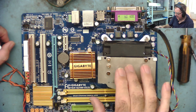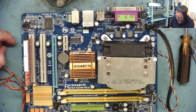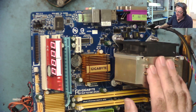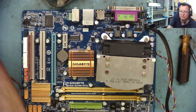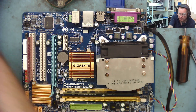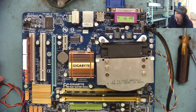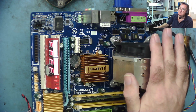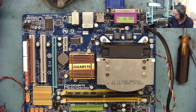So this is their processor, this is my board. I haven't put the RAM in - I want to see if this bleeps, which it should. The POST analyzer's running and it's bleeping - so that board's running. It looks like their CPU is good. Let's try their RAM. So I've put their RAM in. Power's on - boot her up. Yeah, one bleep. You can see the POST analyzer there, and I had a picture on the screen - it's asking me to insert the boot device. Okay, so we know their RAM's good, we know their CPU's good.